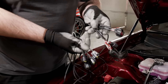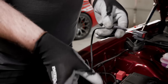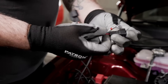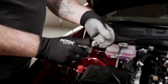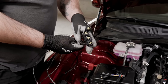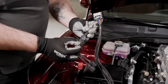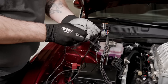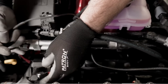The second harness included in the kit is the extension wires — these range up to 8 cylinders. We will now plug the extensions into the main harness so that it can read all 8 injectors. Same as the main harness, connect the red wire to the side where it beeps. Once all the male connectors are connected to the extension wires correctly, connect the extension wires to the main harness. The harness is now ready to be plugged into the fuel injectors. Make sure these are a snug fit.